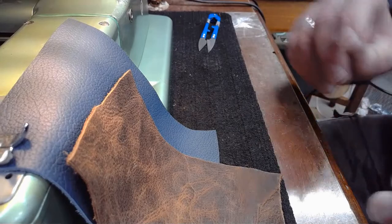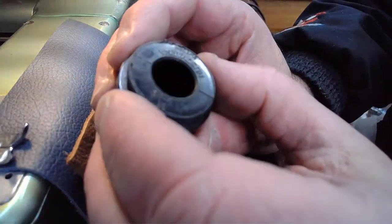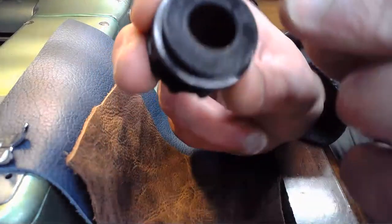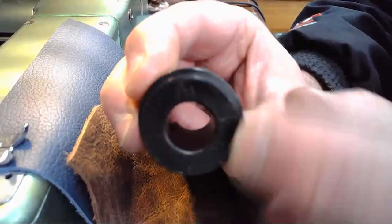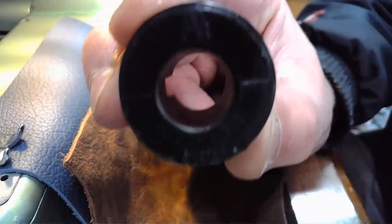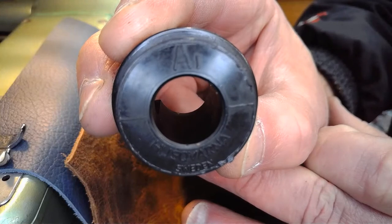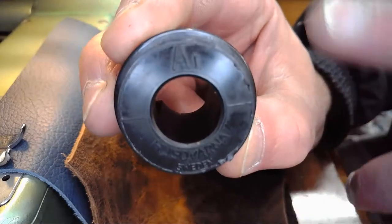And the way you can tell if you happen to have a cam, I'll just show this to you real quick because it's good to know. If you have a cam like this, where if you look real close, you'll see that it has an A and then what looks like a little mark after it that looks almost like an I. Let me turn my light on again, see if that helps. You see that? It's like an AI. That's telling you that this is a revised cam.